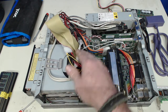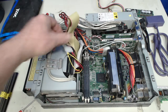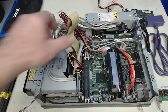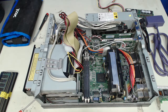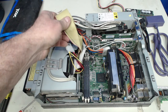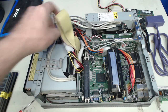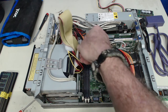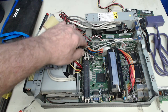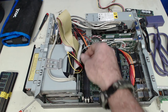Now, IDE cables and the diskette drive cables, there used to be an aspect of termination back in the old days that you made sure of, and of course on the SCSI interface, termination is always a concern, and that goes over very long distances, so the signals are up higher. I'm not really sure. Normally you see diskette drive cables even as long as 18 inches or 2 foot, but they're strictly internal cables on these ribbon cables. IDE cables, I think by convention, are typically no longer than 18 inches, even though I've seen some that are probably a couple feet or a few feet maybe.